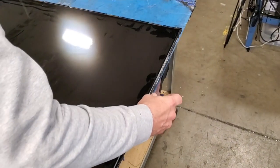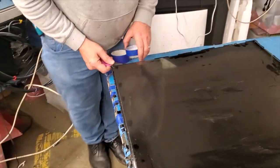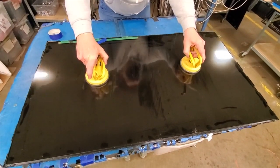Using that plastic piece, slide it beneath the TV panel along the chassis. This will help to ensure that there is no glue or tape that is holding the panel to the chassis. Do this very gently. Then lift and remove the TV panel with suction cups.